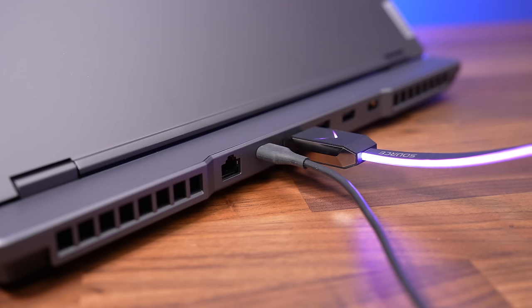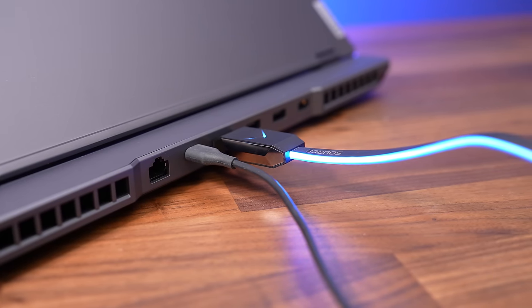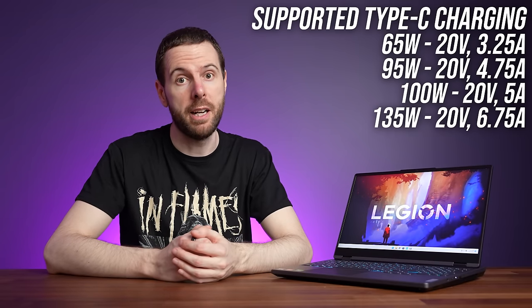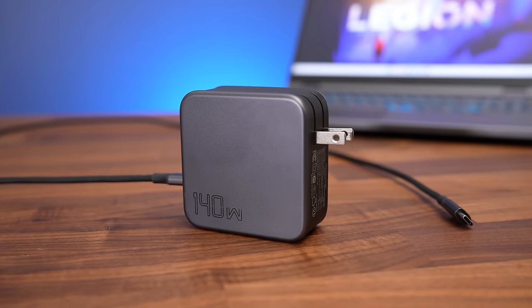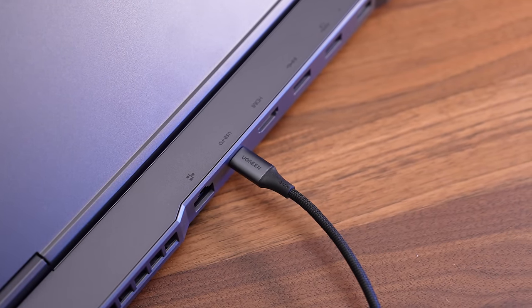We confirmed that the HDMI port can run a 4K external screen at up to 120Hz 8-bit with G-Sync. If you want 10 or 12-bit then you're limited to 60Hz. Only the Type-C port on the back can be used to charge the laptop, and Lenovo updated it from 100 watts last year to 135 watts this year, but only if the charger supports 20V 6.75A — it doesn't seem to support the PD 3.1 standard, meaning my 140 watt Ugreen charger maxes out at 100 watts. Lenovo has their own 135 watt charger, so you may need to buy that to fully power this device over Type-C.